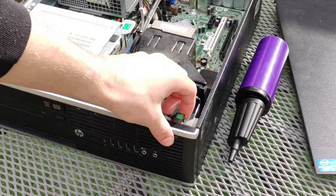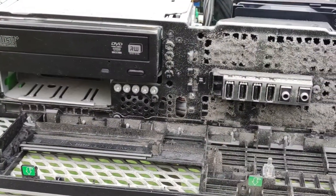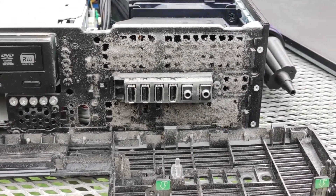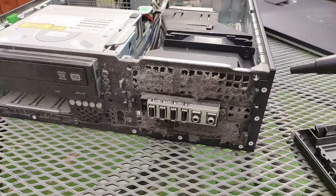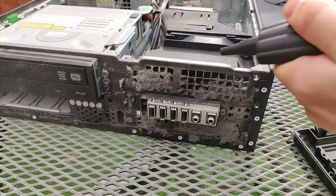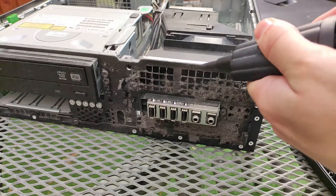To remove the front panel for cleaning, detach it from the clips on the top and pull it off when it's loose. As you can see, this machine is absolutely filthy from the time it's been used. These machines don't feature any sort of air filtration so they suck in absolutely everything. I strongly recommend you dust these outside, as it can make a massive mess indoors since the dust can get into carpets or clothes. Later on I cleaned the front of this machine more thoroughly with an old toothbrush.